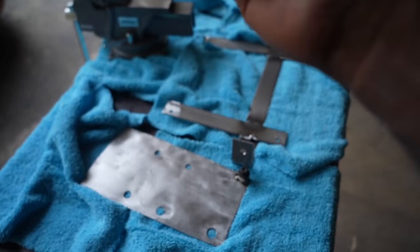So we are going to move to the fuse box right there, and we're going to locate which one comes on when the ignition is on. Right now the ignition is off, so it's trial and error. We're just going to check which one comes on when we turn the ignition on. The way it works, you have your negative, the black one, put it on the negative side of the battery. You can put it anywhere else where you can get a ground. I have ground over here, and I'll be tapping in each of these fuses.